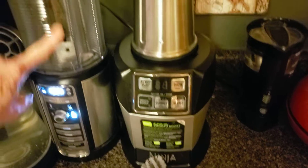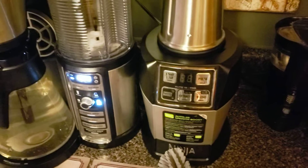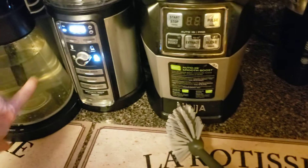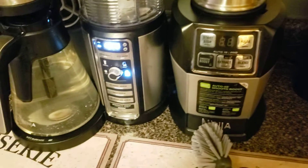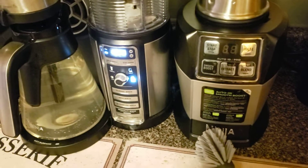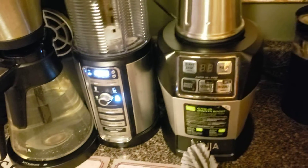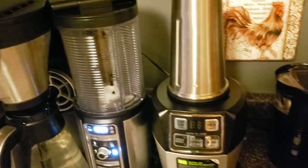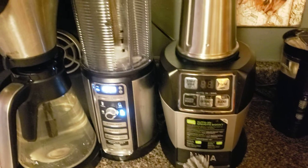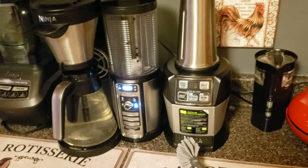This looks crystal clear — I don't know how that's showing up on camera. The other trick is that usually the vinegar and water will clean the pot — it's super hot water, you can let that sit for a bit. Don't forget: once you clean this with vinegar, run spring water or filtered water through it three or four times until you feel it's not going to have your coffee tasting like vinegar and it's completely rinsed the whole system out.